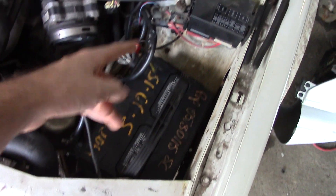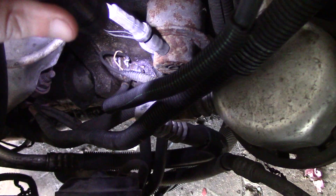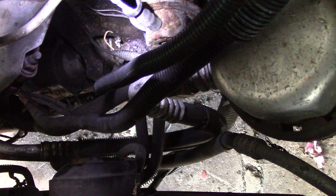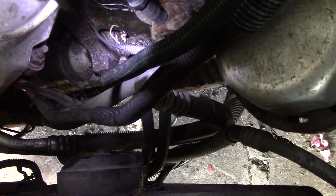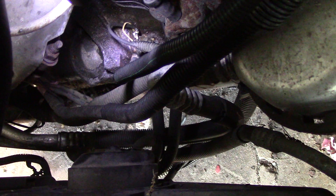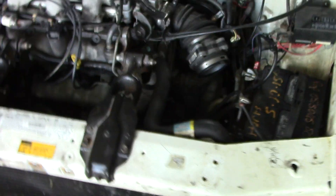First thing I did, because it was misfiring, I wanted to check all of my electrical connections, my grounds, and all of my vacuum lines. I checked my grounds and positive wires to see that they were all tightened up. Right off the bat I noticed — using my trusty flashlight — the ground wire to the battery going way down there: two wires at that grounding spot, a small black one and a small tan one, were both unclipped from that bolt. The main battery cable was also loose, barely holding any of those cables on. It's amazing the car was still running with that being that loose. I tightened everything down, re-put those grounds back on, and confirmed against both Luminas I own in the pull barn that all three are indeed ground wires.